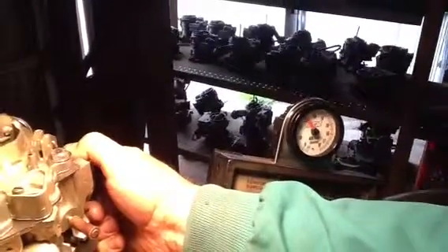We've got Bill Erickson's carburetor here. We've got the mixture set about 12 to 1 on the idle, and we're just probably about 13 to 1 on the high speed.